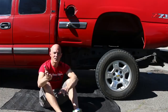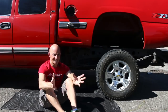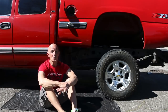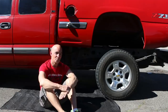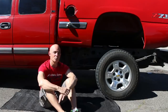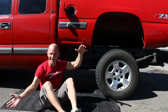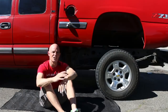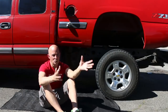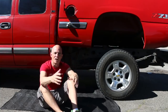And think about it this way, if we were to put that supercharger spinning that speed and that size on a 500 horsepower motor or a 600 horsepower motor, we would actually see vacuum between the supercharger and the motor. It would actually be sucking on the supercharger. So we're just kind of in between it providing boost and it creating vacuum. We're kind of right at the 0 point. So anyway, that supercharger didn't have enough airflow spinning that speed to feed our 4.8.